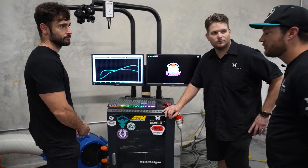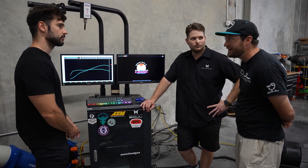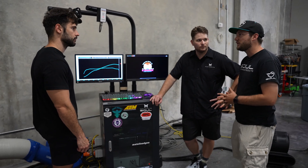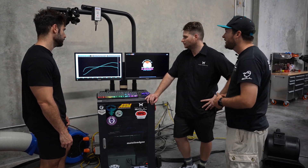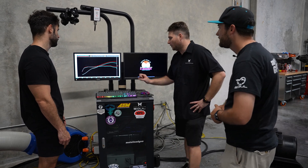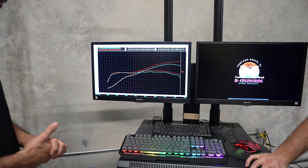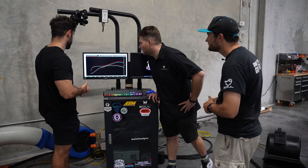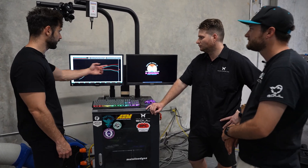What's the first thing we do? There are two ways people go about modifying these cars. Some people don't want to do any exhaust at all and go just software. The red line here represents the same stock exhaust configuration but with software added on top. You see gains through the entire rev range — 384.9 horsepower. That's 384 versus 355, roughly 30 wheel horsepower — about a 10% power gain across the entire rev band on a non-turboed car. Then the yellow line shows just over axle pipes: 372.8 horsepower.